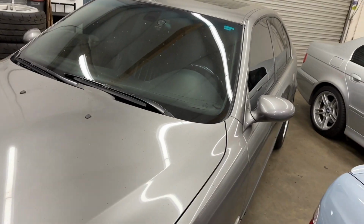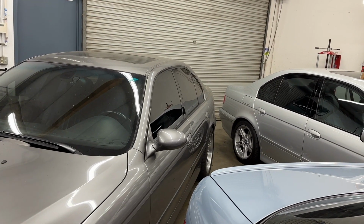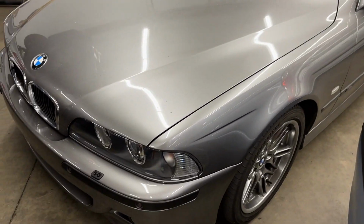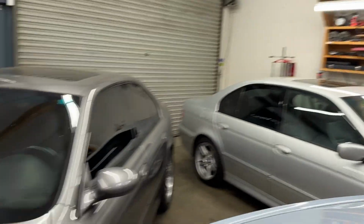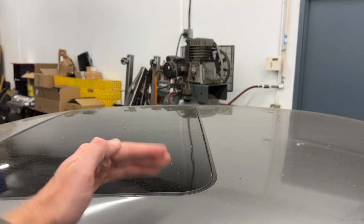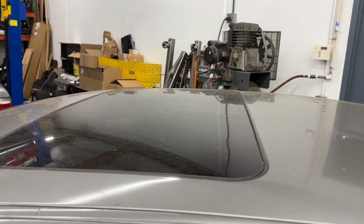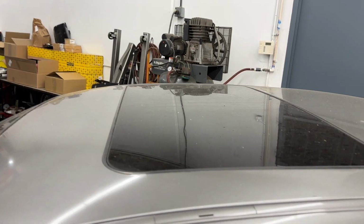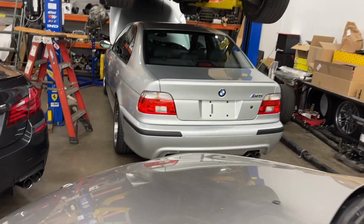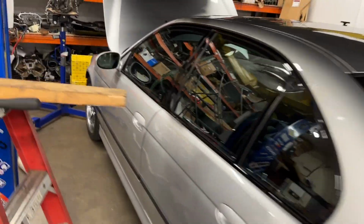Josh's car is still pending a PDC sensor, but that came in today, which will allow us to finish the rear bumper assembly. I've got to get the headlights aimed in here when I can drive up to my level marks on the wall over there. And then we've got to pull the sunroof glass to see what is making all this noise. And if you push the glass, it comes up. So it's those little plastic arms that are responsible for tilting. I'm not sure if we're going to be able to replace that without dropping the whole headliner and replacing the entire cassette, which will likely be cost prohibitive due to labor. Steve's car, we're really hung up on that front bumper impact strut thing because this one won't adjust.